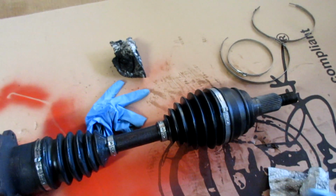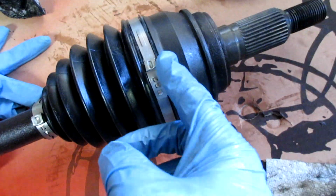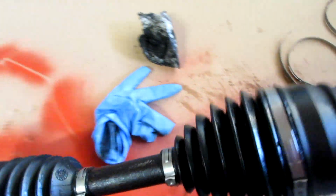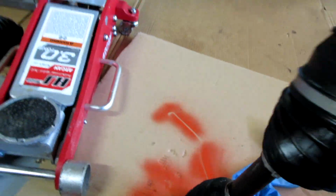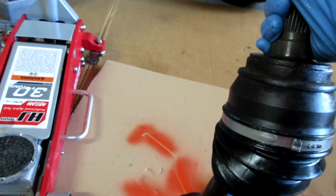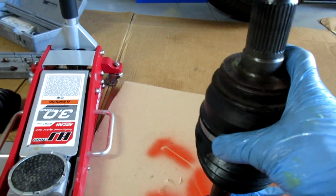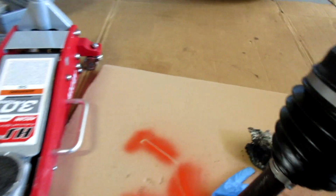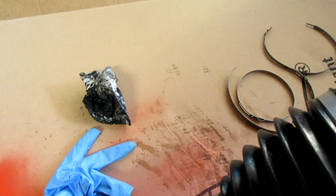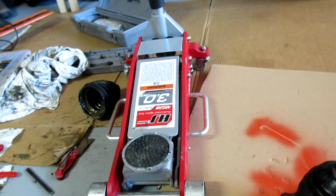I rebooted my axle. Alright. Looks good. I see I put a little too much on it. What do you think? I think it's going to be fine. If you go like this, wiggle it all around, I think it's not popping off. I was always thinking about using a little RTV around the ends too. I think it's unnecessary though. Alright, done. Throw it back in.